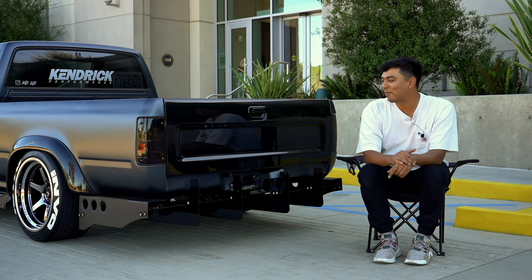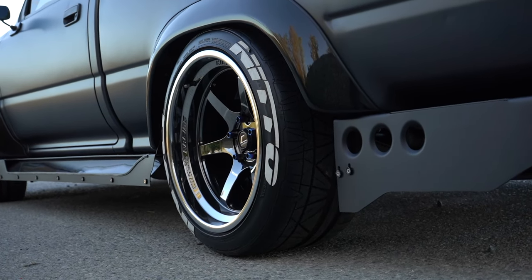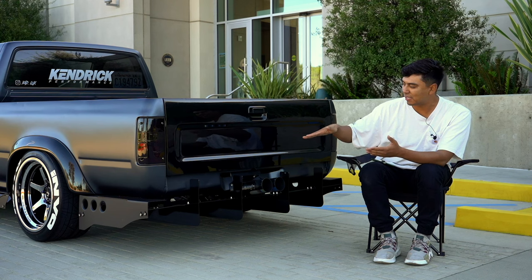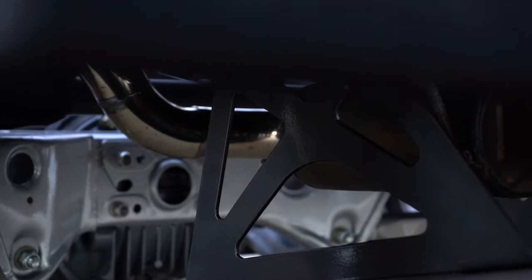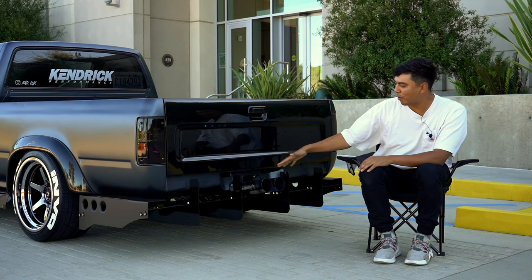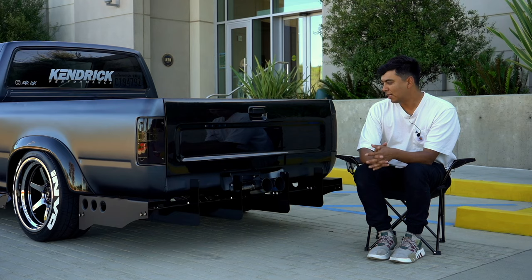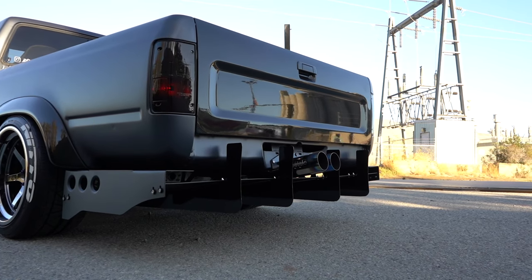This brings us to the chassis-mounted rear diffuser. The side pieces are level with the side skirts all the way up to the front splitter. It has three dimple dies, and right in between is a flat plate that clears the suspension components to make it aerodynamic. It's mounted right where the spare tire used to go — there's a big middle bracket holding the center part. To reinforce the sides with the dimple-die pieces, we added two splitter rods, one in the front and one in the back of each piece.